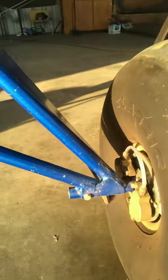Basic landing gear - bolts, bungees, etc. Take a look at the brakes, make sure everything is alright. Look for proper inflation on the tires. Make sure all the bolts are in place for the struts and all other bolts as well.